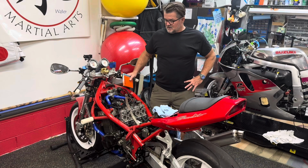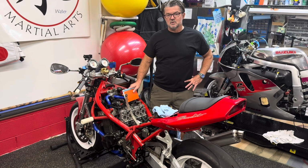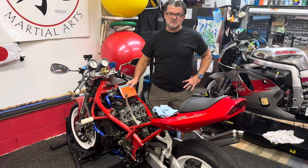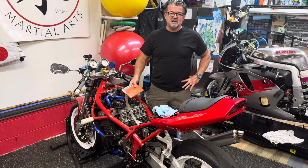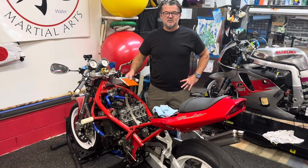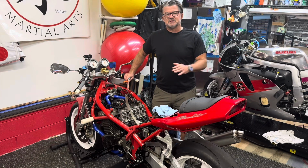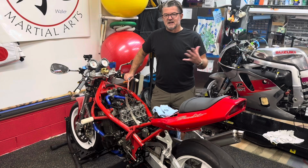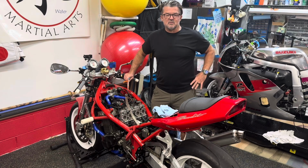So I think the vacuum leak is coming from one or two of the intake boots, which would be expected because I remember I had sent the head off to get work done and the intakes were removed and then they were put back on before they shipped it back, which was nice for them to do, but I didn't send new seals with the intakes, and that's kind of like a miscommunication, my fault too. I should have expected that they'd have to do that, and I should have sent seals with it when they did the work. So I got new seals coming.